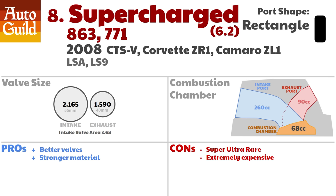Launched first on the 2008 CTS-V in the 556 horsepower supercharged LSA engine, these heads are mostly the same specs as the L92/LS3 heads, but are made of a stronger rotocast A356 T6 alloy for supercharged engines. The 771 heads for the LS9 use titanium intake valves like the LS7 — that was on the 2009–2013 Corvette ZR1. These are crazy hard to find and insanely expensive, but luckily you don't need them.